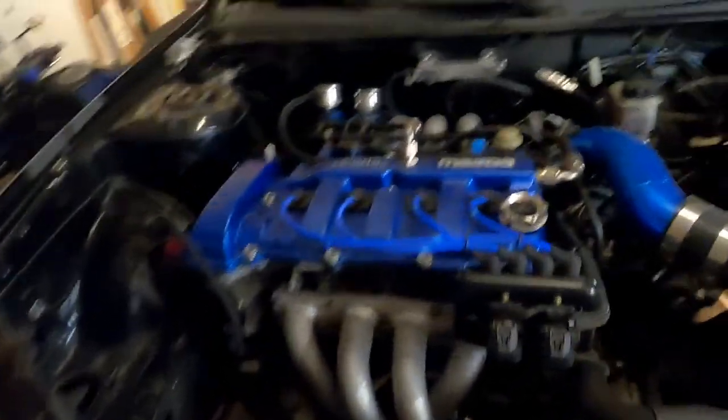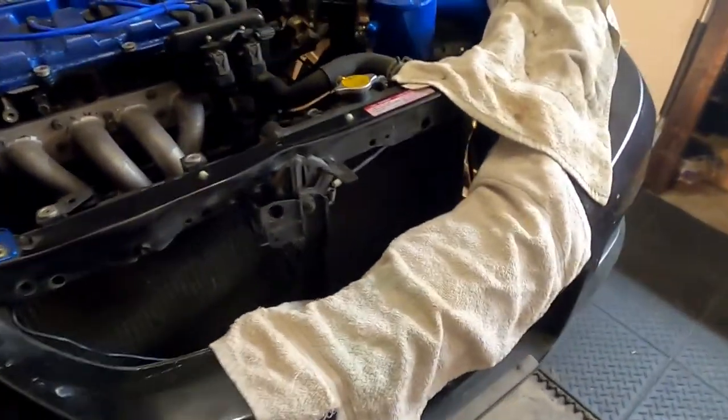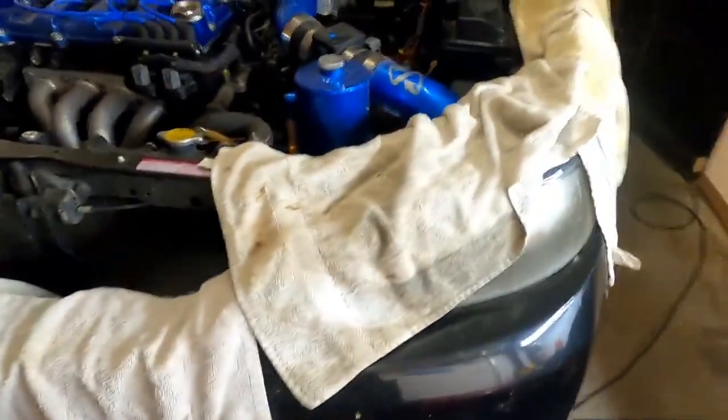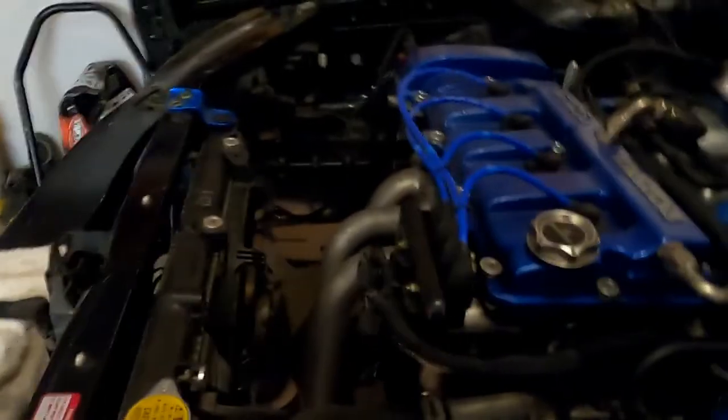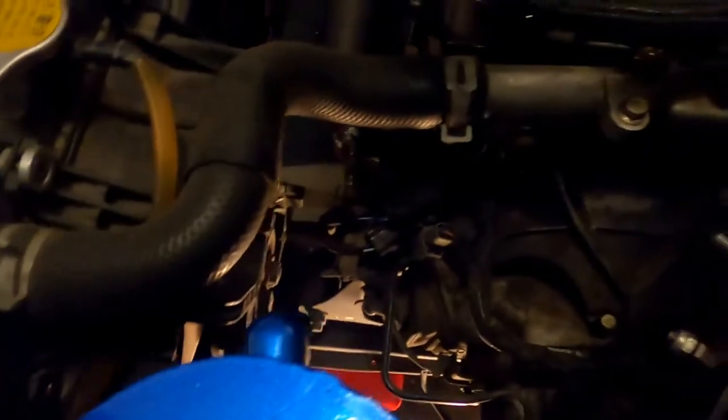So luckily for us, there's two motor mounts on Mazdas. This one, and there's a rear mount. Back up in there, there's a video for that. We are going to support the engine anyway, which I'm not happy about. Didn't think we'd have to end up doing that, but that mount on that member down there would probably be as easy to take. We're going to take that out too.